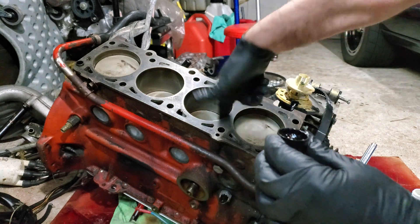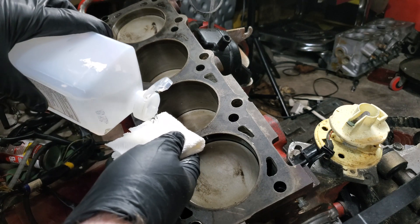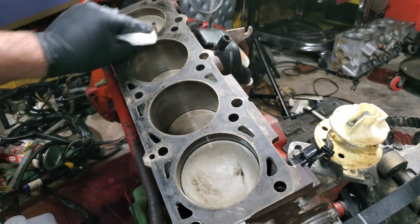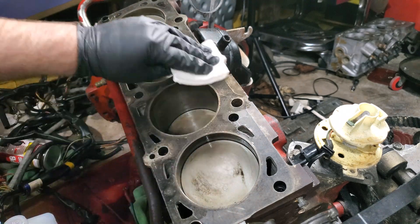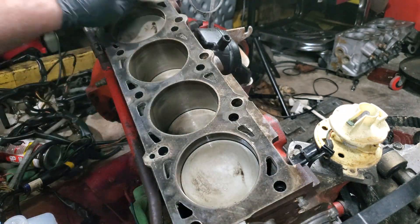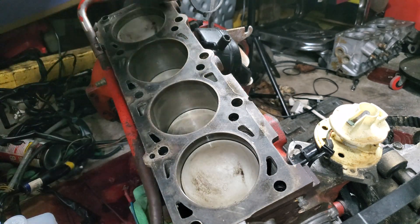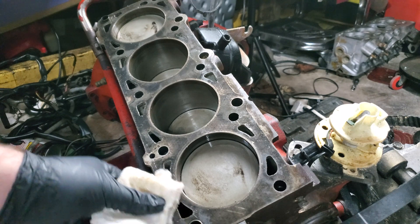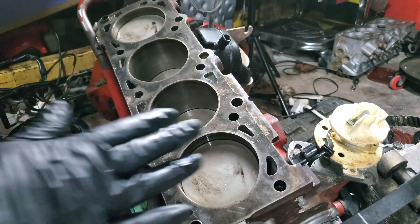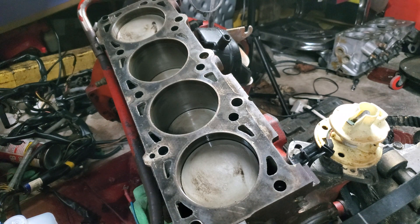What I was doing was folding up rags, putting some regular alcohol on them, and wiping — wiping, wiping — a tedious cleaning effort. I want to add a sticky to this surface because I know it's a little rough, and we didn't have the money to take it to the machine shop and machine it. So I'm going to do a little preventative maintenance and apply some sealant.